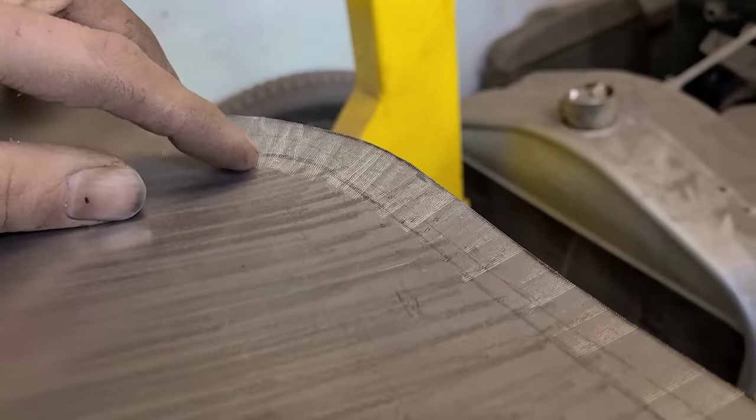Little tip here, if you're not building a show vehicle and you're doing rocker panels or cab corners or something, and you've got a single layer inner panel, you've got good access from the backside to get your welder in. I punch all my holes for the plug welds into the inner panel, weld it all from the back, and then I got way less grinding to do on the outside of the panel, and I don't bother grinding anything from the back because it's just getting undercoated anyways. So just a little time-saving tip there.